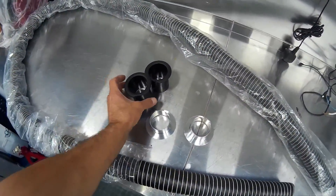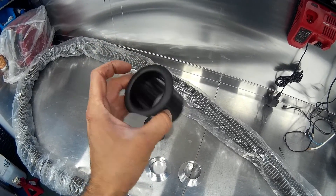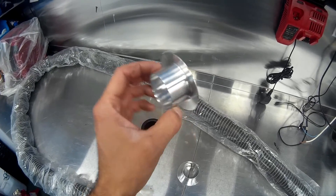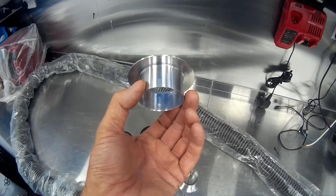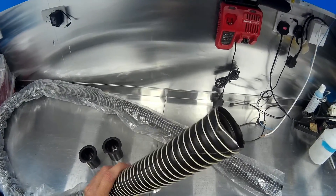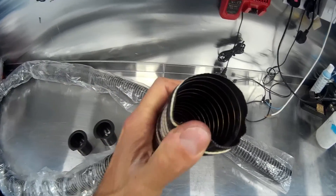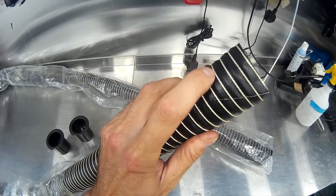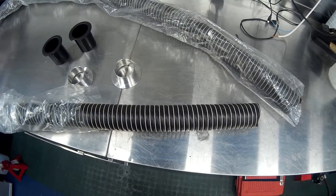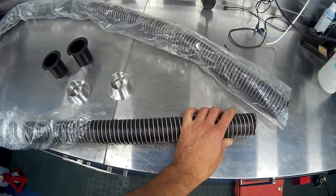Here are the parts we need. For the intakes on the front fog lights, we're going to use a pair of 51mm plastic base ports, available off eBay for a couple of quid. For the back of the brake disc protective shield, we're going to use a pair of Revotec 51mm top hats. For the ducting itself, I'm using some 51mm silicone air ducting with reinforcing metal wires and cotton reinforcing on the outside — highly flexible and exceptionally good at keeping its shape when red hot.